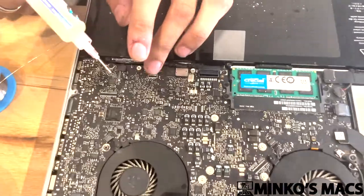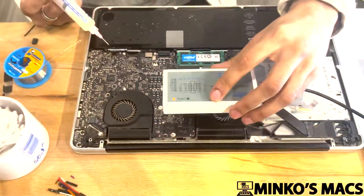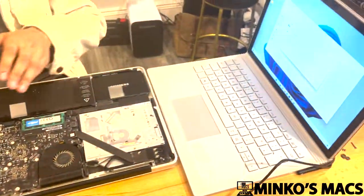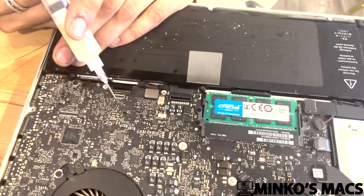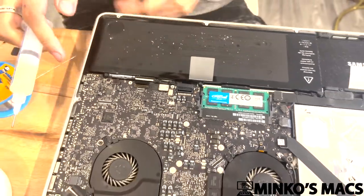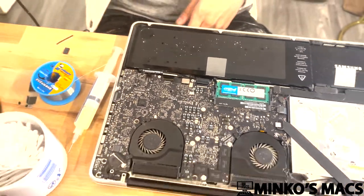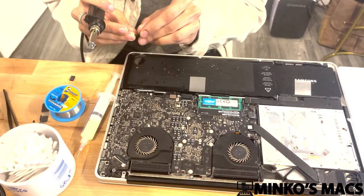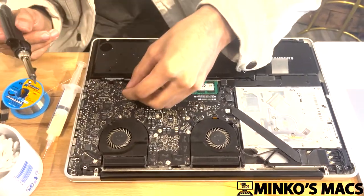The first thing you want to do is make sure you have the following equipment: a lattice programmer and a Windows machine. To start off, you want to go to the PL reset resistor, which on this 15-inch will be here. What you want to do is jump a wire to it, to a ground point. I will demonstrate doing that now.